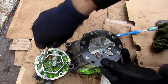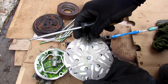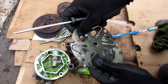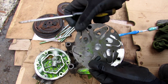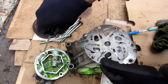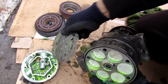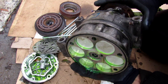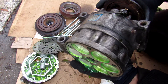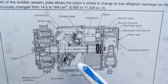These valves align to the circle of the input side from the pump in the middle. Flipping this over, we have another shim with valves built in that allow refrigerant to either go in, exhaust out, or lock altogether. The outside circle aligns with the input of the AC refrigerant on the outside circumference of the back. Now, check out what happens when I hook up the clutch and turn it — you can see the pistons moving up and down as I turn the AC compressor, each piston taking its full stroke in turn.